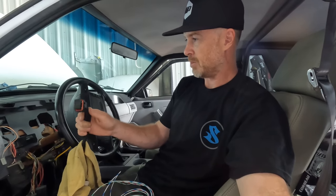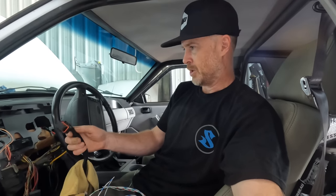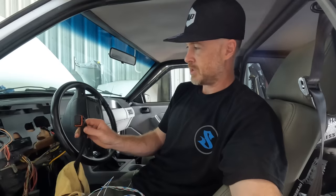All I know is that input number 7, which I need to validate what the pin numbers are, is for the fuel level sending unit. And I'm gonna be adjusting that directly off of the factory gauge. So I'm gonna have to figure out the ohm reading. Pinning it is no big deal. It's just how many ohms does it register when the tank is full? Obviously when the tank is empty, that is 0. So there's that guy, and then the two 12 volt inputs for the turn signals.